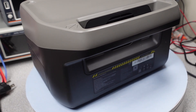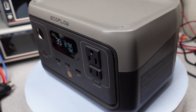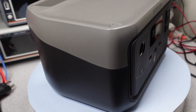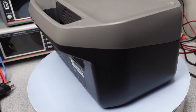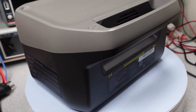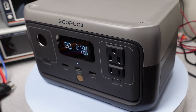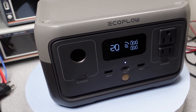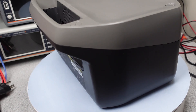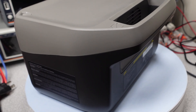This power station can do so much and manages everything in a very easy to understand and simple interface and display. I like that it can be charged very quickly — less than one hour — and it does so with very clean power usage, power factor corrected all the way. The ability to act as an uninterruptible power supply or UPS is another nice feature. It is not an online UPS and it doesn't claim to be, but it does have the feature that it could keep some smaller appliances online longer than a traditional UPS. The multitude of DC output options mean you can use just about any device on this power station. The USB is very capable, offering three non-negotiating ports — two at 12 watts for low power devices and one at 60 watts for laptops. I think it finds a great balance of feature set and value.